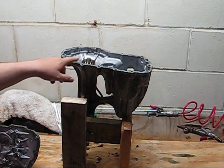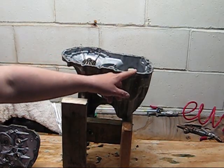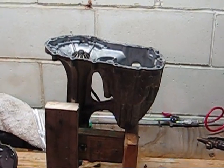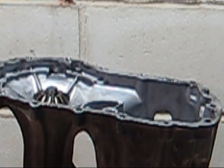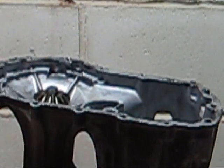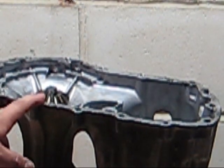And then when you get ready to put the silicone on, clean it well. Use something that degreases, that's going to break down those oils. Because if you go to put that silicone RTV on that case and you haven't cleaned it spick and span, where you can take a nice clean rag and there's absolutely nothing on that rag, your silicone isn't going to hold very well.